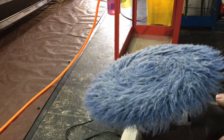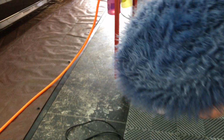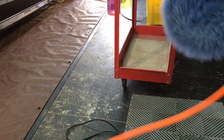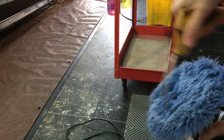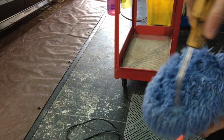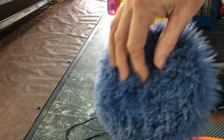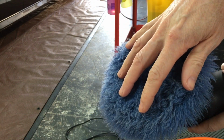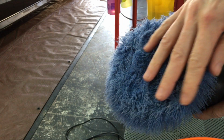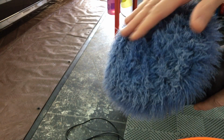I use both the brush, agitate it a little bit, loosen up that compound the best I can, and then follow up with forced air. Now, as you can see, these fibers are starting to separate once again. They are working individually. You'll get a more consistent cut, and you will reduce any chance of marring as you continue polishing.